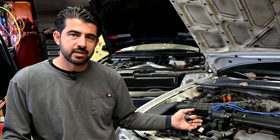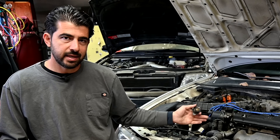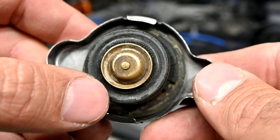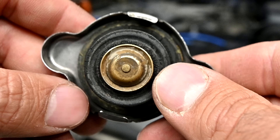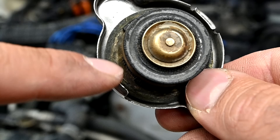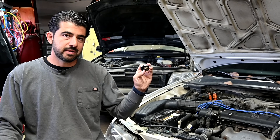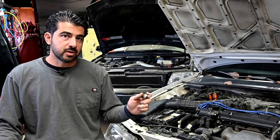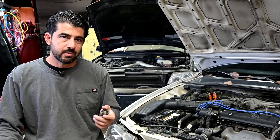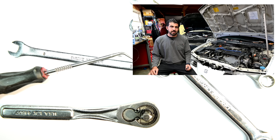When you have coolant leaks or overheating issues, it's not always the cap or pressure regulator — but since this is fairly easy to test, you want to take it out when the engine is cool and inspect it. Not only inspect the valves and make sure they move freely, but also take a look at the gaskets. This upper one is cracked in multiple places — it's really old — and the lower gasket is missing rubber in some areas, which could cause a leak or suck in air during the cool-down process. A visual inspection isn't definitive; to know for sure whether the valve opens at the correct PSI, you'll need a cooling system pressure tester with a radiator cap adapter. If you want to see how that works and how to find leaks inside your cooling system, subscribe and hit the bell notification.